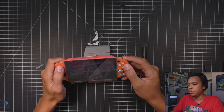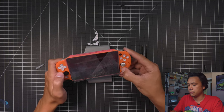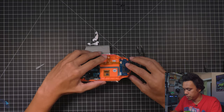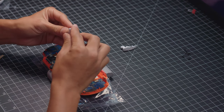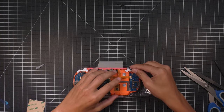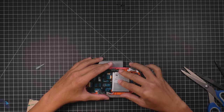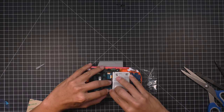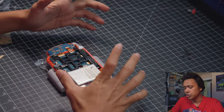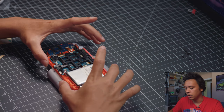This is a good time to check and make sure all of your buttons are clicking. If they aren't clicking, you might need to go back and reset them into a better position. Go ahead and put our L and R buttons back in. Grab our battery, set that in, and plug that right there. Now at this point, if you want, you can actually turn the Vita on — just be really careful and make sure everything works. But I like to put the back on first personally.